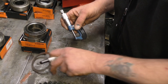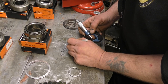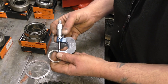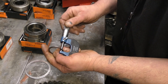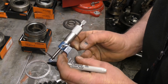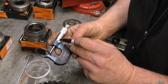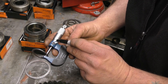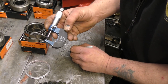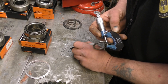And then the other one is the shim for setting the preload. I can't quite see that very well, but that is 2.85 millimetres. Right, so the next one is the preload shim. You take things to bits, you remember where they are — if not, use a microfiche parts list which will show you exactly where it's supposed to be. These do come in different sizes — they're selective shims, which means you have set sizes. I think this one was 3.33 millimetres.